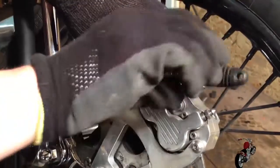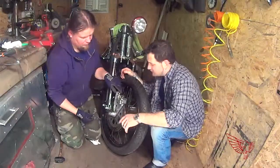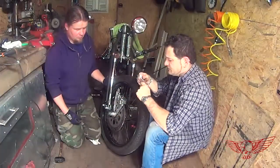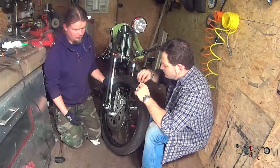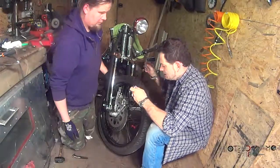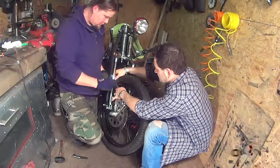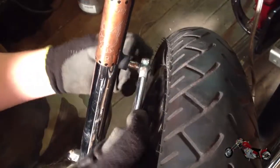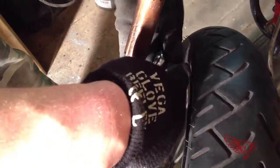But what we will be doing to complete the brake assembly is getting this retainer that needs to be installed between the bracket, to keep it in place, and the rear rigid fork. And we do that using a bolt in the back that bolts directly into a stud that comes out from the rigid fork, factory made.